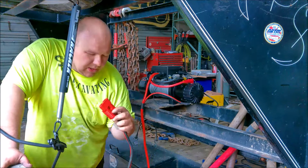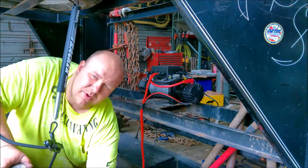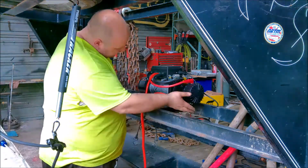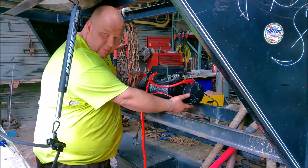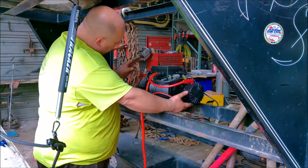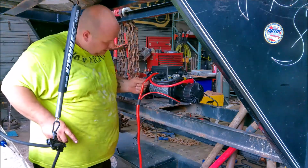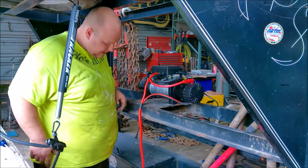These are pretty sweet. Kits can be found on Amazon. They have jumper cable accessories and stuff like that too, pretty sweet. So I just went straight with the negative, or the ground, to the bottom of here where this little wire is, and they recommend you take the battery ground to. And then I disconnected this wire from the inside and just ran the wire from this harness deal in there. So we're permanently wired to plug into the back of the truck here.